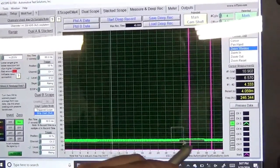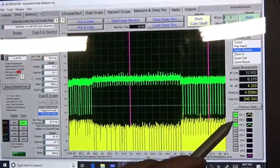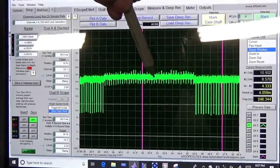Zooming in on the area of interest: the voltage goes from 14 volts here, and every time ignition coil number one strikes, voltage drops down. Right here is where I jumped a clean source of voltage, bypassing the harness — and we can see those voltage drops no longer occur. Through the use of good service information, applicable knowledge, and appropriate tools, we were able to determine not only the source of an ignition fault but pinpoint it to a specific circuit and coil, and prove that the coil wasn't working properly because it wasn't being supplied everything it needed — voltage supply, reference to ground, and good control.